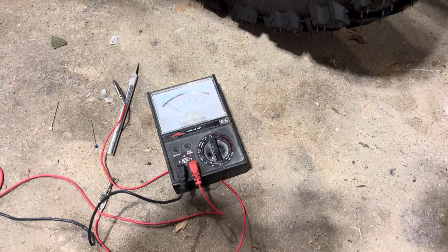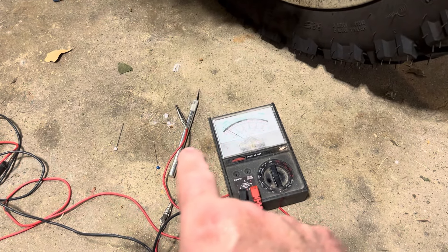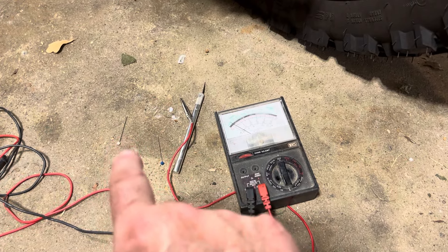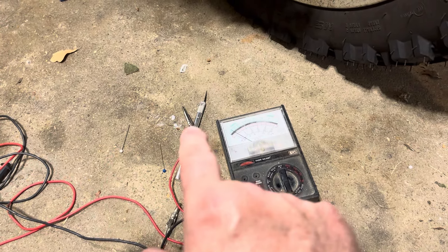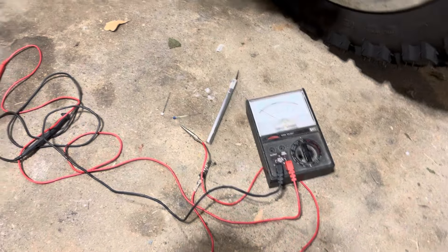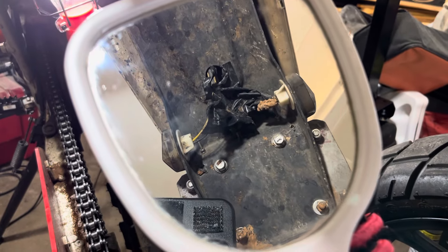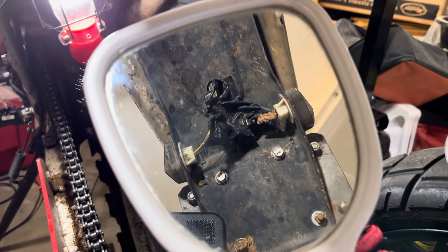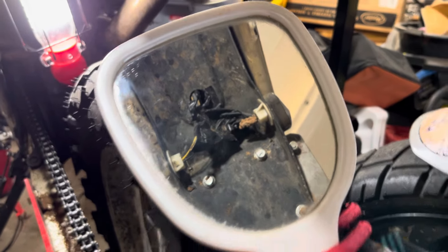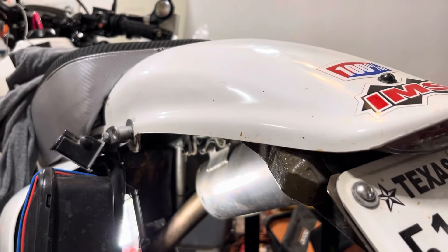So this is my strategy. You can see there's a bungee and a mirror. I've got my old voltmeter here. I have a razor knife to cut the tape away and I'm going to get some scissors. I have some pins that I can use to stick in the wire so I can alligator clip the pins to the probes and take a reading. Then I'm going to snip the wires in there, extend them, and put on some shrink wrap and get this thing working correctly.